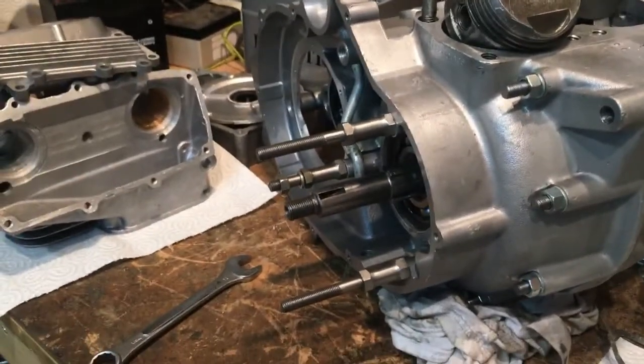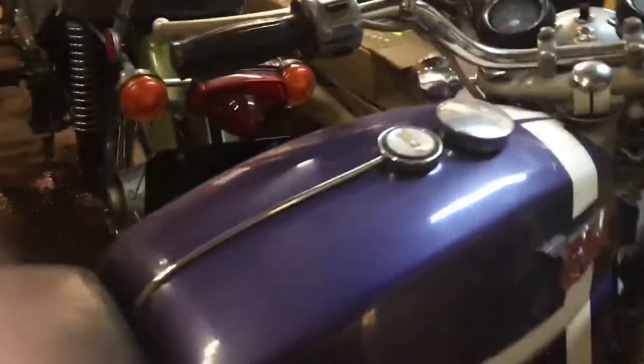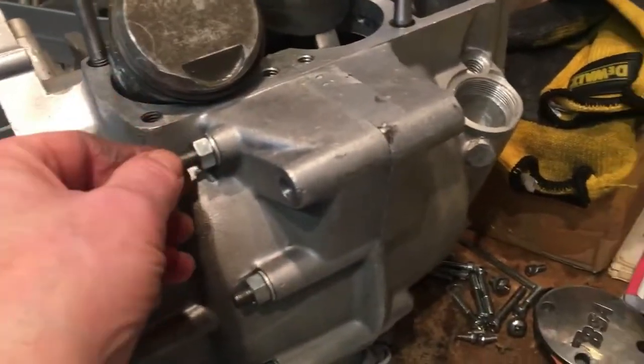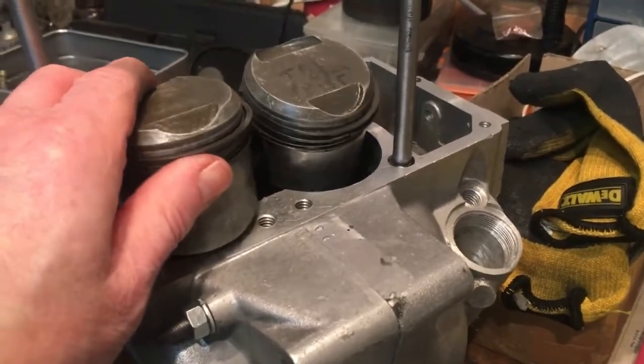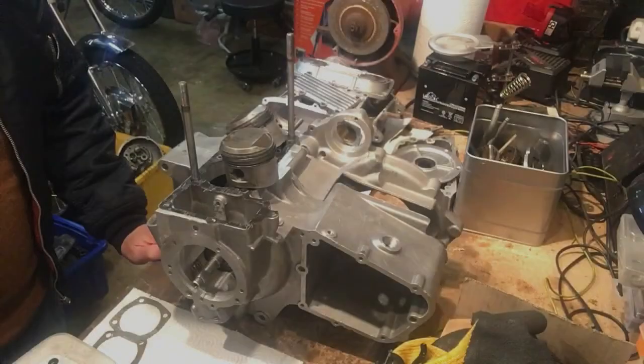When I looked at both the Bandit and the Fury - if we go around to the original show Fury you might see this, though it's rather dark down there so you may have to take my word for it - down there the crankcase halves are definitely held together with bolts, which isn't what it says in the parts book. So we'll go with this. That one just needs tidying up once we've got the barrels on. We're not doing any damage to the pistons, so I'll remove these nuts and prepare the base with the gasket.